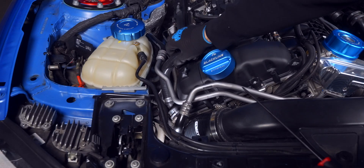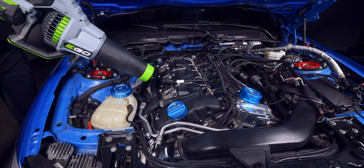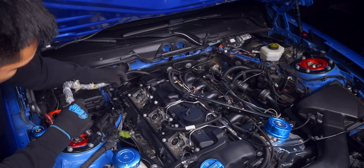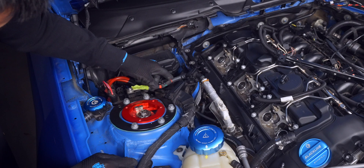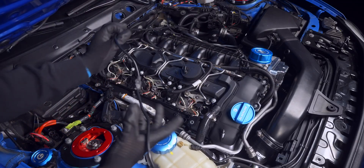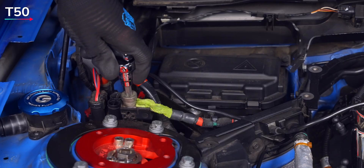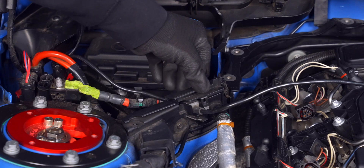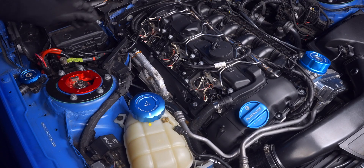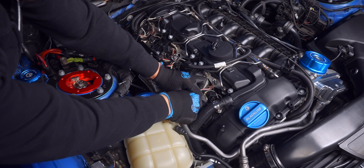Blow away any dirt before bringing back in the wires. First, the guide cover that goes over bolts 20 and 26, followed by the power cable that runs directly on top of it, then onto its designated guides leading to the terminal. The wiring harness lays on top of the terminal wire in the back while having its own dedicated outline on the valve cover. The last wire plugs in behind the positive terminal — secure it by its locking tab before doing the same for the power cable with the T50. Hand tight is enough. Then place back on the retaining clip. For the T25s, four should have coarse thread on the left while the one with fine thread on the right is for the O2 sensor — test fit yours to be safe. Double check the three for the wiring harness are lined up before driving them in.